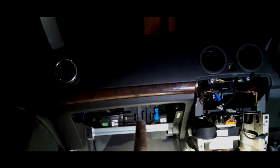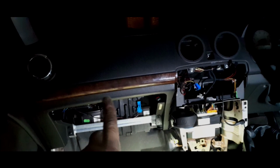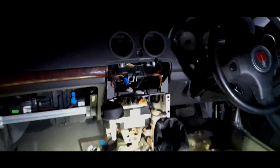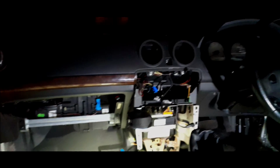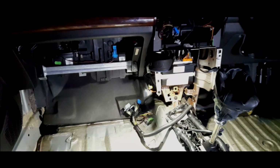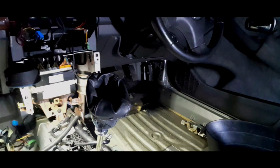I am aware that there could be some issues with the drains below the wipers, but to be honest, when I've put a hose through where the wipers are, where your scuttle is, if the drain holes are blocked, I wouldn't see water coming out on the other side. Down below there's a drain channel on either side, and I see the drains are fine. So there's no evidence to me that at this time the drains are causing an issue. So yeah, that's a very curious one. But yeah, we're gonna just keep cracking on.